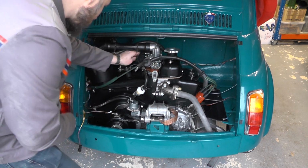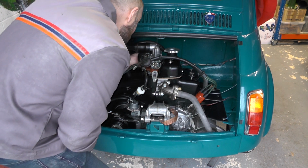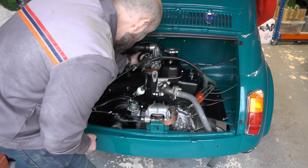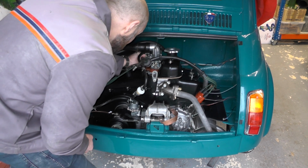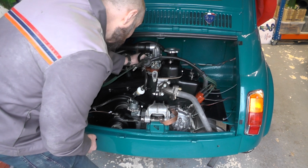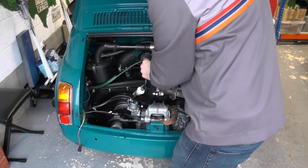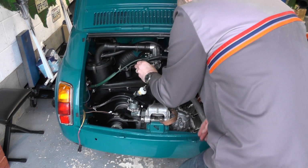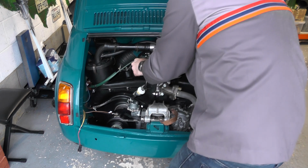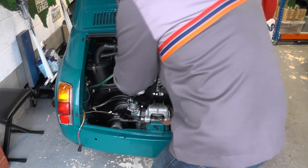Put the back one back in first. Positive click into the, there we go, push our piece protecting it down, and then we'll push our little plug in here. And the purpose of this little rubber plug, as I'm calling it, is to make sure that the air that's being generated by the fan doesn't just come out of the holes where the spark plugs go, so it kind of traps, or should trap, the air in, hopefully.